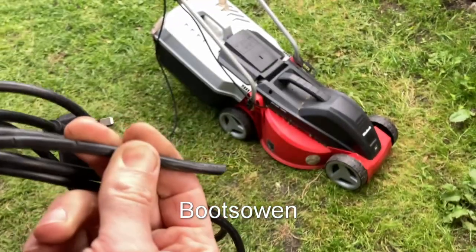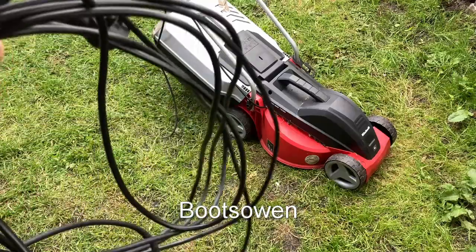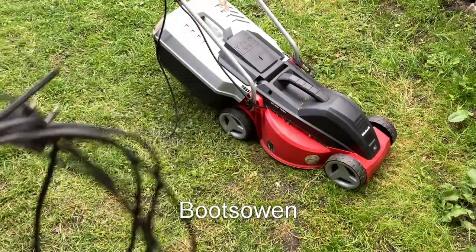The cable looks like it got a couple of licks. This is a thing that happens to a lot of these lawn mowers of every kind of electric kind. If you're not paying attention you drive over them and you give them a lick. If you've got a residual current device in your house or if you're using a special plug with a residual current device, there's really no issue at all other than it interferes with your progress.